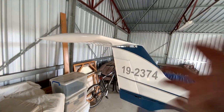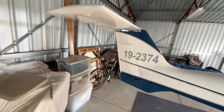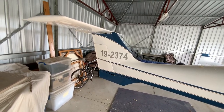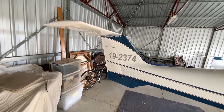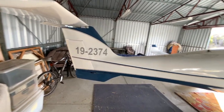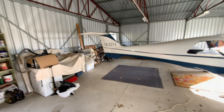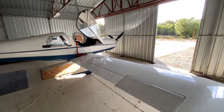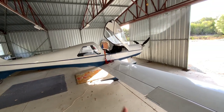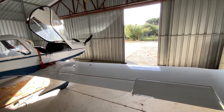Here's an Achilles heel that kills everyone if anything goes wrong, and there's not a lot of redundancy or built-in strength in the system. By the numbers the math might tell you those bolts are strong enough, but those programs don't account for dynamic loading — they just can't. Dynamic loading has a lot more load spikes, and pilots are an inventive bunch who find new ways to crash every day. You probably started looking at this plane going wow that's a nice looking airplane, why aren't these everywhere — and between the tail falling off and the flaps giving asymmetric flight controls causing a rollover, there's not a lot that makes you go yeah, I should go hunting for one of these right away.